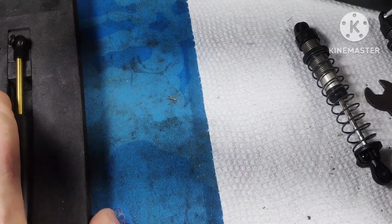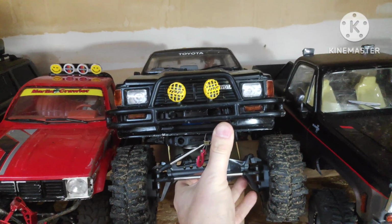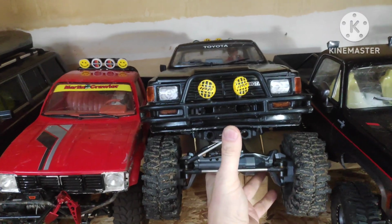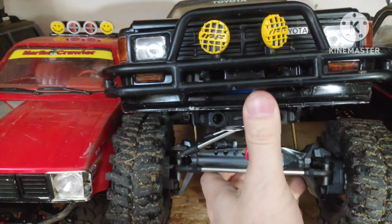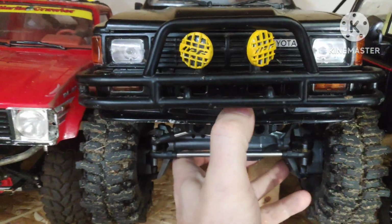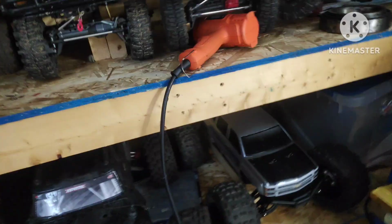So I'm also going to show you what happens with these. This truck is set up, it was designed to be on a 90 mil shock or under. So as soon as you put in that extra length, see how much that bends out? You get that bump steer? That's what's going to happen on one of these rigs, unless you hold it up to be at a more stable height, which you do with like a heavier spring. It's not too hard to do.